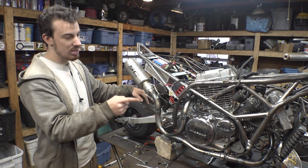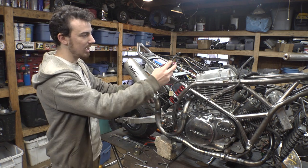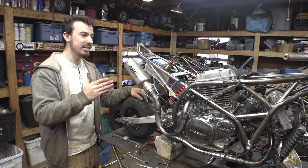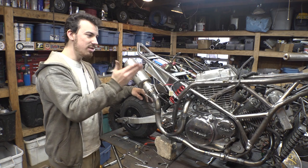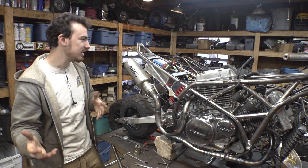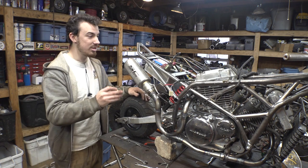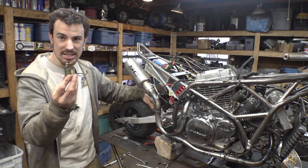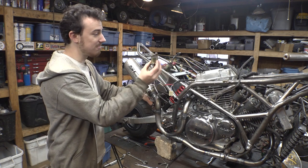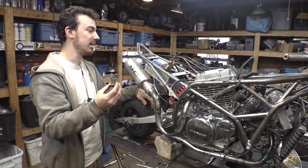The starter motor does work, so it's not that. I took a pair of pliers and touched these two leads and it turned over. I kind of think it could be the starter solenoid. I'm grasping at straws right now, just trying this, trying that, and right now I want to try the starter solenoid. So I just pulled this starter solenoid off of a Tillotson engine, actually, and they look very similar. They both have two wires coming out of them.